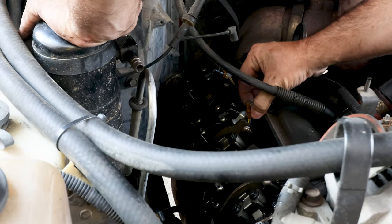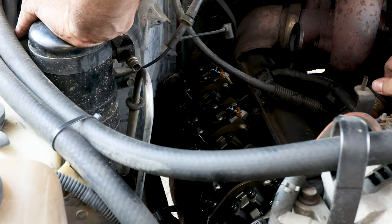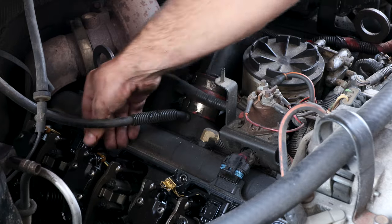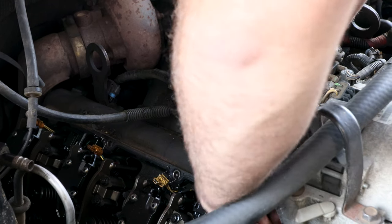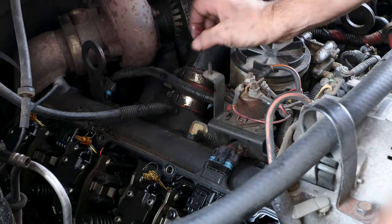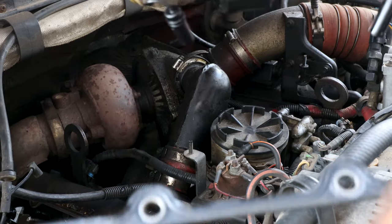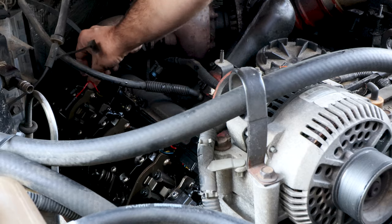There's your problem — number five. Can't hear any difference at all when it's unplugged. This glow plug is actually smoking currently after I cranked the truck and it heated the glow plugs. The glow plug relay is still working because it is definitely still melting that harness. We may wind up replacing this harness anyway since you have to pull it out to change the injectors. She's done — she's gone. Hundred thousand mile harness.